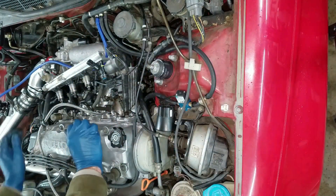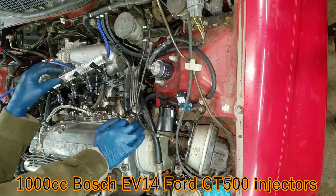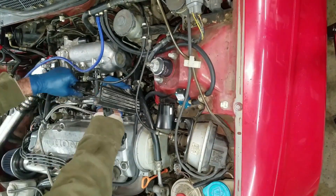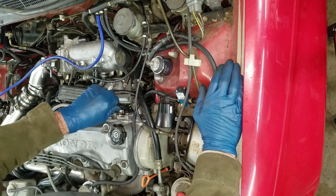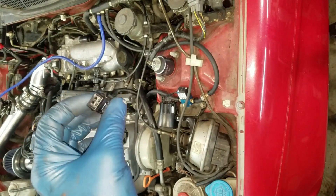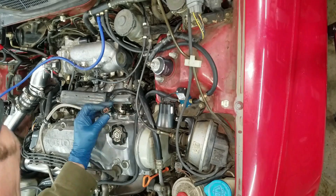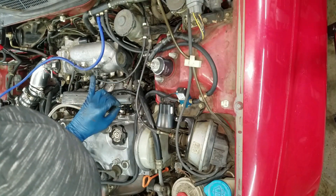I've got the double O-ring setup — the one on top is the original. That goes in there real nice. I've got all four of them in. These should be conical too, meaning they have a round spray pattern, so it shouldn't matter what direction I have these pointed. These are OBD1 connectors — that's what they're listed as — so they're probably for an older Honda. They look like a GM connector. I'm going to take these apart too. These aren't the same — damn it.